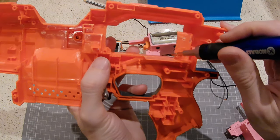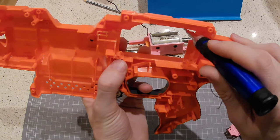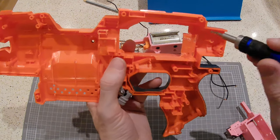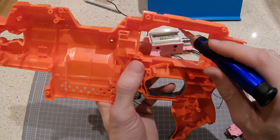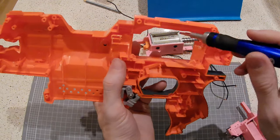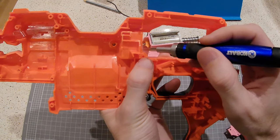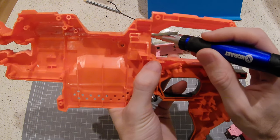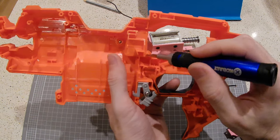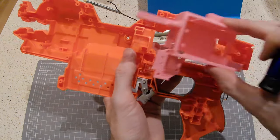From a little divot point you're going to go straight up, and once you get to the top you can open it up a little bit more for the wires to go in — you don't have to but it's a good idea so you can get wiring through the battery tray. Make sure it's nice and open all the way up here for convenience. Then it comes down here, and roughly in line with the centre line of this screw hole, go straight down and then come out and down at an angle. This screw hole here and this one will be used to retain the solenoid, allowing us to sit it in place.